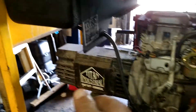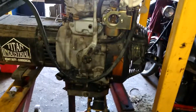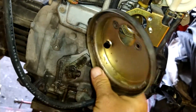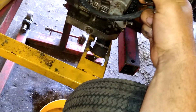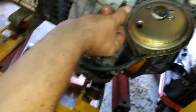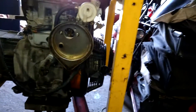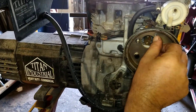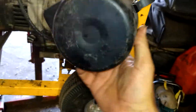The tank — I just used air and blew it through until it was all blown through and there was no water or dust in it at all. We're going to stab this hose into place on there and then get it lined up. Two 10 millimeter nuts with 10 millimeter bolts, get it all on. Make sure your air filter is good and blown out and dust free. Set it in place with the canister, pop it all together, and that's it.